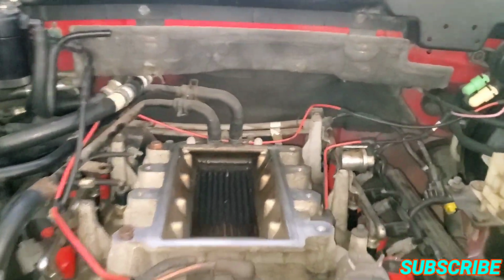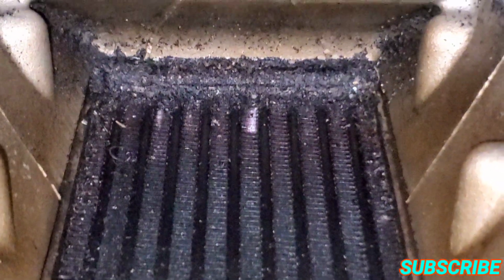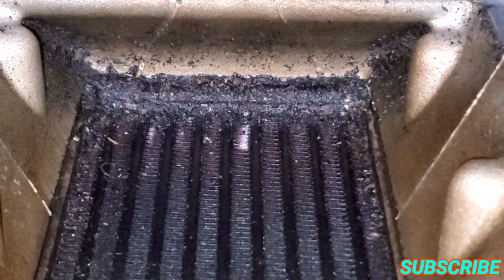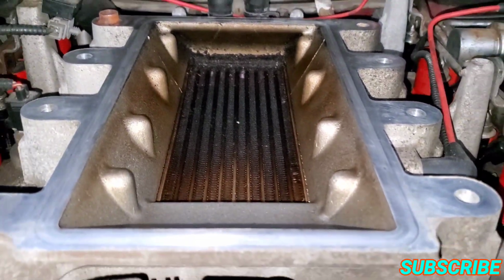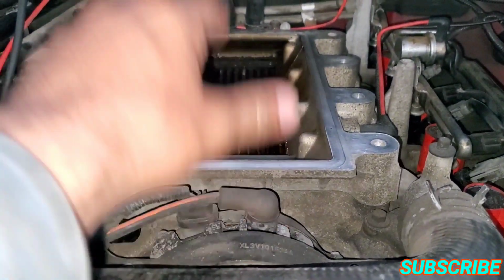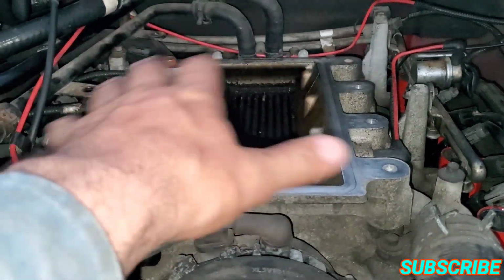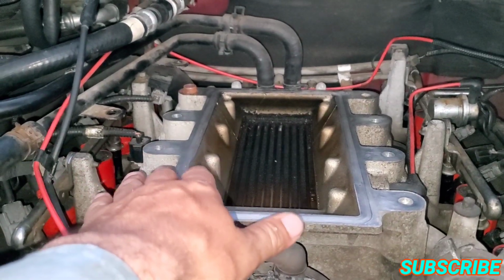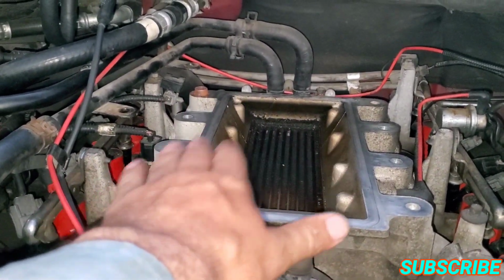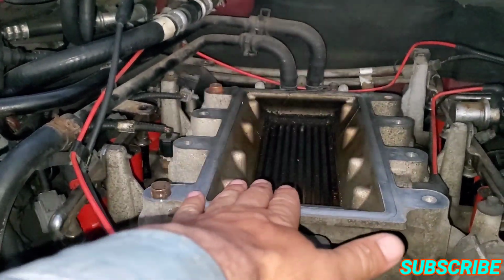All right, guys, so the supercharger's out. So I'm gonna show you guys. That's your supercharged intercooler, and it's pretty damn dirty, but not as dirty as the other F-150 you guys saw before. But we're gonna clean it out. We're gonna remove the turkey pan, remove the intercooler, clean everything out. I'm gonna do a video, or I'm just gonna show you like a little quick glance, because I've done videos before on my channel. If you guys want to see those, they're at the bottom of my channel, so just go by them and you guys see them. But we're gonna do that.